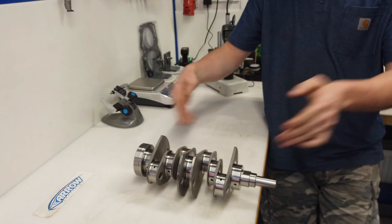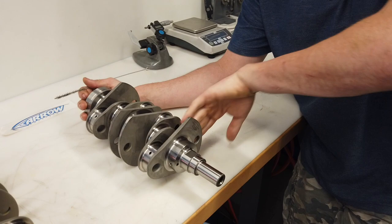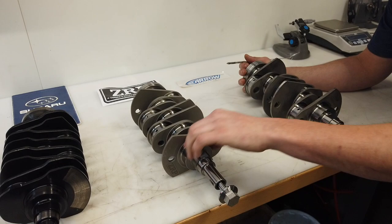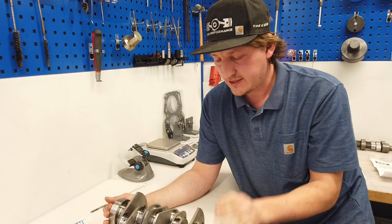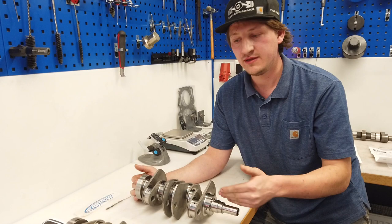And I see that the surface of the material of this crankshaft feels pretty good. This here feels a little bit like a normal casting. I don't know why it is like this. Maybe it is cast completely and then only finished by a CNC machine. But it feels nearly the same as the original one. And this is here complete with a glint finish. And I think that the oil channel design is the biggest pro of this pretty expensive crankshaft. But when I see how it is machined, it's normal that it costs so much money.